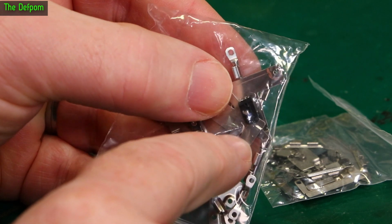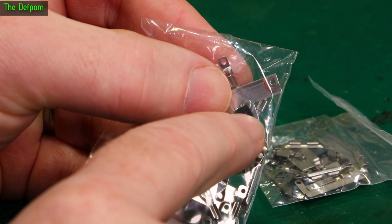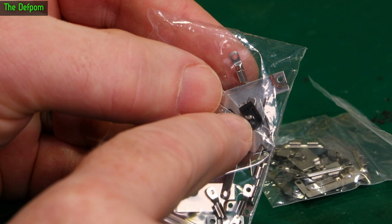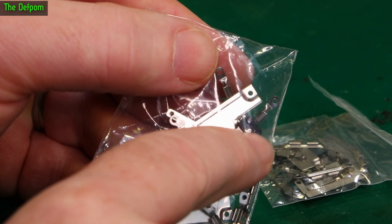My iPhone 6S Plus, it's got one of these in it, but it's got a crack right through there. And it's not a great connection. This is for the cellular antennas. Goes through this. So it adapts on the circuit board onto the frame of the phone. And that's what that piece does. But one's actually got a big crack through it.